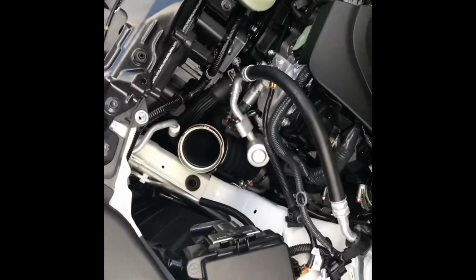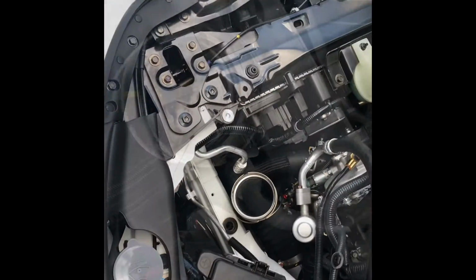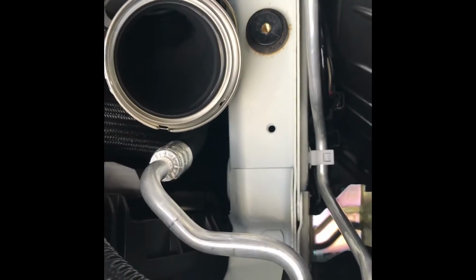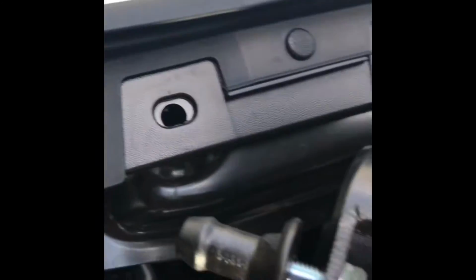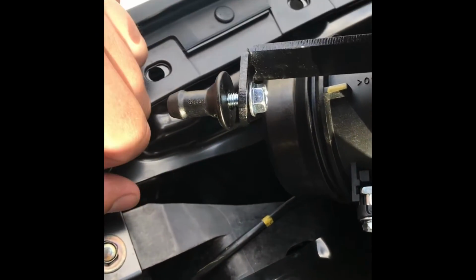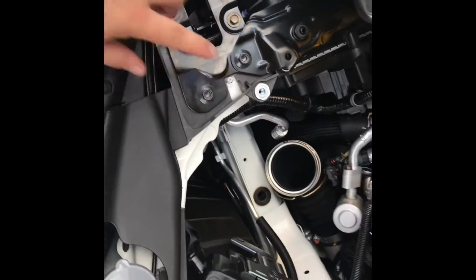Set. Now we're gonna put it back in the retaining clip, bolt it all down, and this side should be done. The kit comes with these little plastic grommets that go in the original holes, so I'm guessing that goes in there, and then the mass airflow bracket connects to that. Backtrack a little bit. First put the little plastic grommet in here, use the 10 mil to bolt it down, then we install it in there. After you install the MAF housing into the retainer clip, you're gonna feel for the push. Once it clips in, we're gonna put one more bolt up here, and should be done.